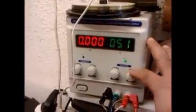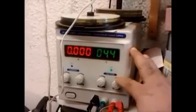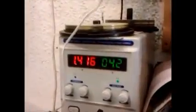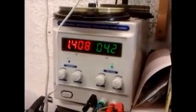We plugged it in for a while to pick up a little bit of battery drain. But we will drop the voltage of the universal charger because the battery voltage is maximum 3.7, so we can put on 4.2, 4.4 also, but that's very high. You see when I plug in, I put the battery connect here. That's it. It's quite difficult. You can see it's picking 1.4 ampere, at 4.2 volt. It means it's getting charged.